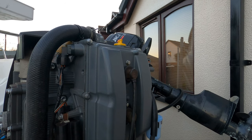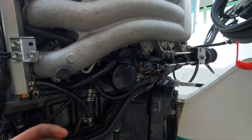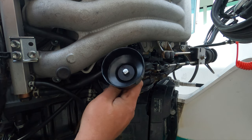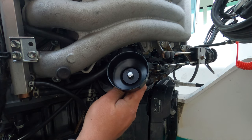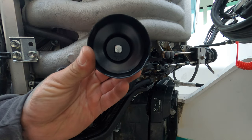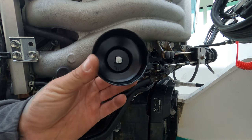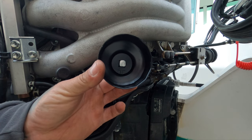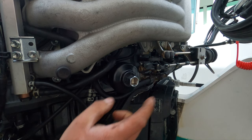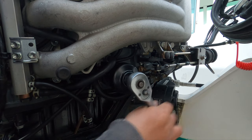The engine oil is drained, so what we're going to do is remove the oil filter next. The oil filter is right here. I've got a special oil filter tool — I'm not sure what it's actually called, but the measurement on here says 68/14. I've got a huge kit of these — a universal kit with about 30 of these caps, so I've never had to buy a single one. It'll fit over the end of the oil filter, get the ratchet on there, and it should undo nicely. Proper tool for the job — no messing about, no hassle.